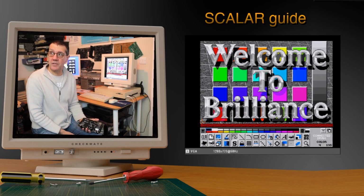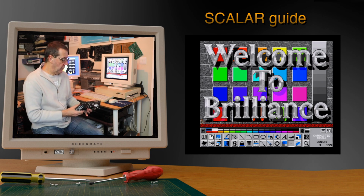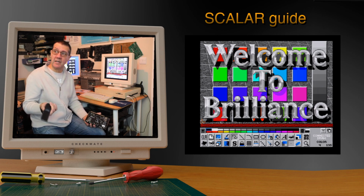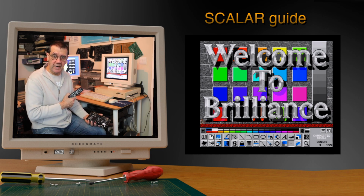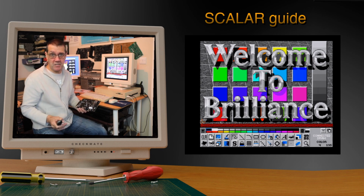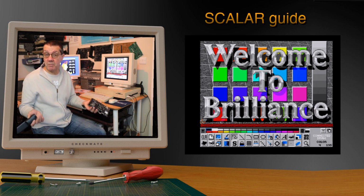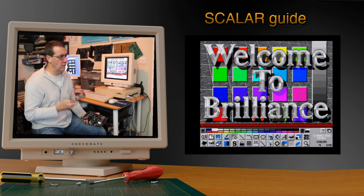And this is the output from the Amiga's RGB to SCART. Now technically the SCART should be RGB, but some SCART cables only have composite. And so I get people saying to me, but Steve, it's not showing anything. Now if you don't have any RGB on that cable, this is why I always say we're at the mercy of cables. People then instantly blame the monitor when actually it can be their cable. I bought cables and they just turned up, they say RGB SCART and it turns up and it's composite only. Very important to understand.